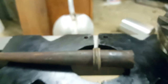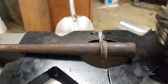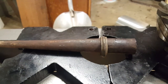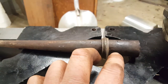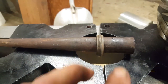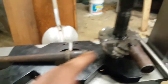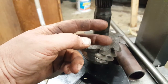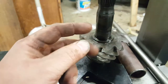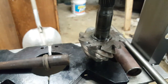I did that, spread mine out, and reinstalled it in my Ford 9-inch ring and pinion — and it worked great. I could tell when I hit the crush because it got really hard, and I put a cheater bar on a half-inch drive, but I was able to get it. Then I crushed it back down to get the proper preload on my ring and pinion bearing, because proper preload is crucial. Once it gets down close, it doesn't take very much of a turn and it really clamps down.